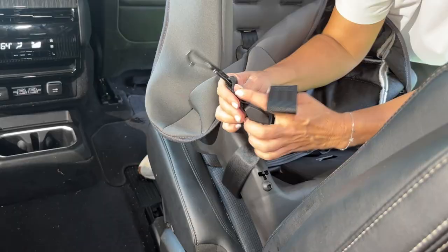I also want you to create some room for your body to move around, so clear the clutter and push that passenger seat forward. We're going to get started first with the installation method using lower anchor connectors. There are two ways you can install a car seat: one is lower anchor connectors — they look like this — and the other is the vehicle seat belt. I'm going to show you both in rear-facing and forward-facing mode. You can only use one method at a time, never both.